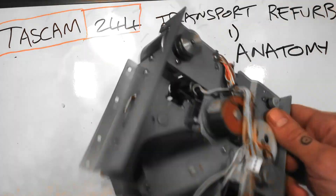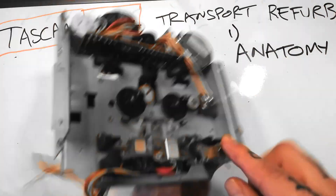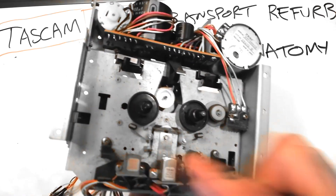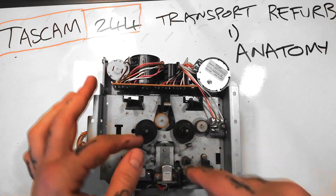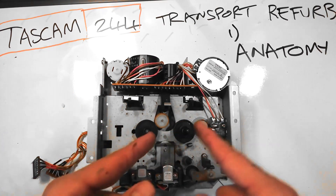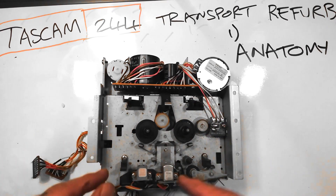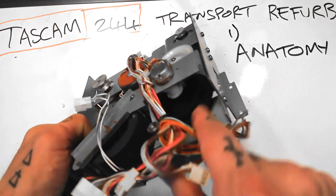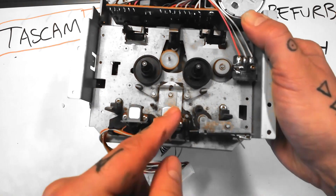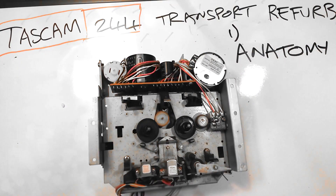So let's do a quick recap. The capstan motor turns the flywheel, which turns the capstan — that's to do with playback mode and getting an even tape speed. The idler motor, via these idler tires, turns either the take-up or the supply reel. That's the only system operating in fast forward and rewind, but it also ensures there's enough tape take-up so you don't get chewing during playback. And finally, this control motor relates to the potentiometer and all these gears, which change how high or low the magnetic heads and the pinch roller go. In the next video, we'll talk about the common problems you'll have with your transport and how to diagnose which rubber parts are going to need to be replaced.